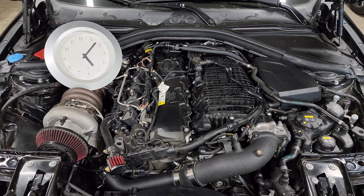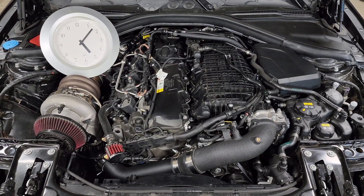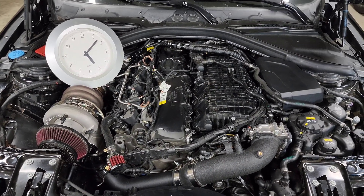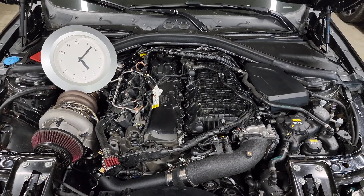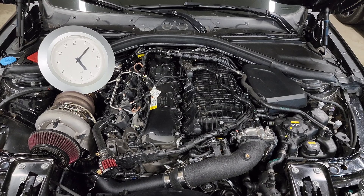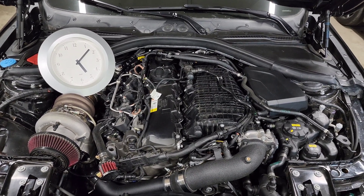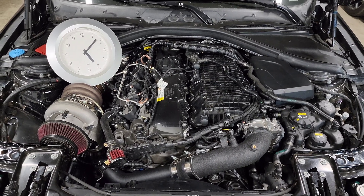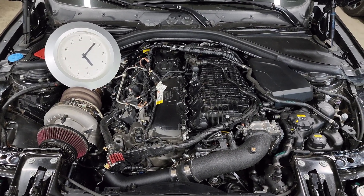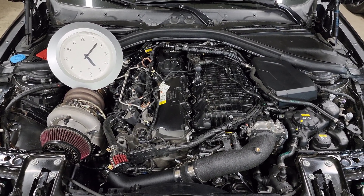As far as corrections are concerned, I usually look to keep things below three degrees. It happens on a cylinder-by-cylinder basis because we have really high frequency sensors that identify exactly which cylinder is having an issue. If one cylinder pulls timing three degrees or less and catches up as it goes toward redline, I consider that not really a problem. But if you're pulling more than three degrees or seeing erratic timing across all cylinders, that's usually when I would try to address it. With off-the-shelf maps, either improving your cooling or increasing your octane will usually give you the best results. Custom tuning is of course much easier to dial in for your specific car and setup.